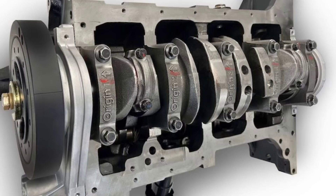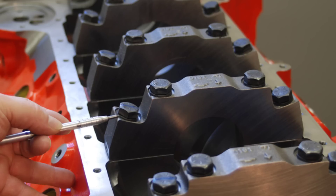Some people mentioned from the picture that it was only a two-bolt main, and that is because they are using the 351 Windsor main bearings — and durability came into question. From my personal experience, I have seen a lot of 351s tolerate a lot of power and a lot of abuse, and that's why they only really needed the two bolt — they were built pretty strong. I know Chevy uses the four bolt, and it's kind of a love-hate relationship between Ford and Chevy. To me, if it works, it works. I don't care if it's got two or four bolts, as long as it holds it together, that's all that matters.